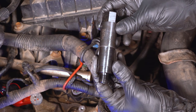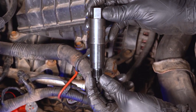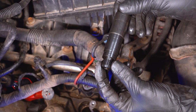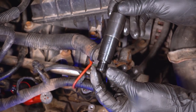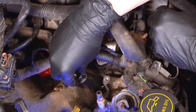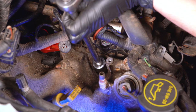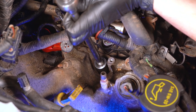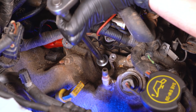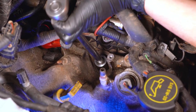From the tool kit, you'll see this threaded rod, which is basically an adapter that's threaded on both sides. At the bottom, it has the same threads as the spark plug that you pulled out, so it'll actually thread into the spark plug threads and lock in there. Slide it down into the cylinder, get a 19 millimeter socket, and thread it down. You want to make sure you oil up the threads a little bit and that the threads on the insert are clean — you don't want to damage the threads in the head. Thread it down until it bottoms out and gets snug.